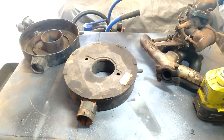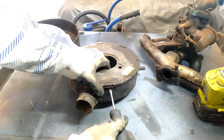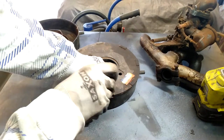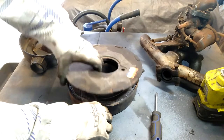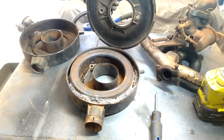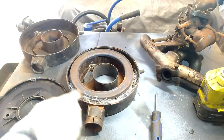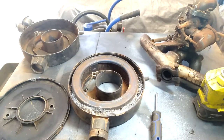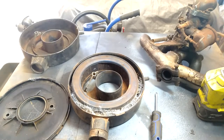The first thing I need to do is open up this air cleaner box — there's a little arrow on here, so I'm guessing I need to sort of lever it up. There we go. Let's check what's inside. There are a lot of spider webs and stuff in there. I'm going to take that outside and give it a clean up. I'll hang on to this actual filter because I need to get the correct replacement for it.